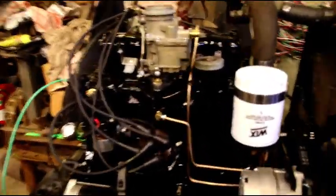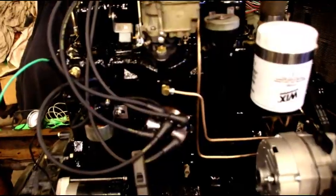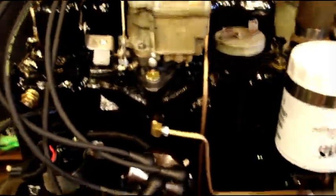Okay Gary, I've got about 35 minutes of break-in time on this. Timing is set. I don't know if you'll be able to see down in there, but I got that marked for you — those two white marks there. Top dead center and five before. I've got it set to five before on your timing. You shouldn't need to adjust that, but if you need to, you can.